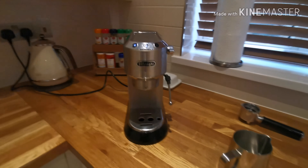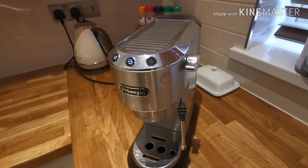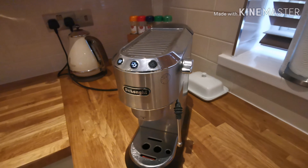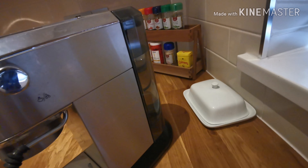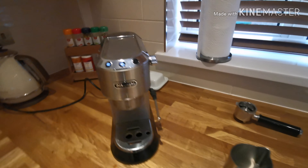So when this is off, as you can see the red light is flashing — and some of you probably descaled it but when you finished the light was still on, so let's fix that today. Firstly, take that off. Water tank — fill it up and put in your descaling fluid. Give it a stir. Now you're ready to go.